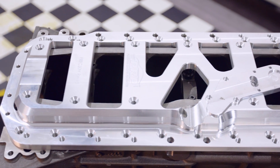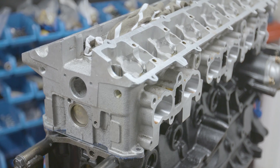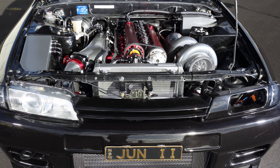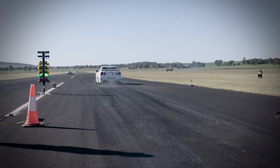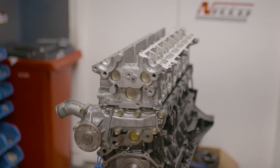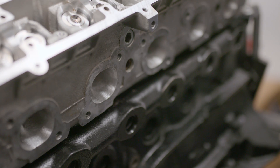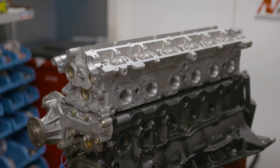The Platinum Brace also spaces the sump further down and helps add some extra oil capacity as well. Our new head is a CRD race-ported item, the same as used in War GTR, Drew's Time Attack R34, and was used in Jun2 up until the end of 2018. CRD are of the belief that the stock RB26 head is good enough that if you're going to port it, go the whole hog and do it properly. Then you choose a camshaft to suit the power, turbo size, capacity and driving style.